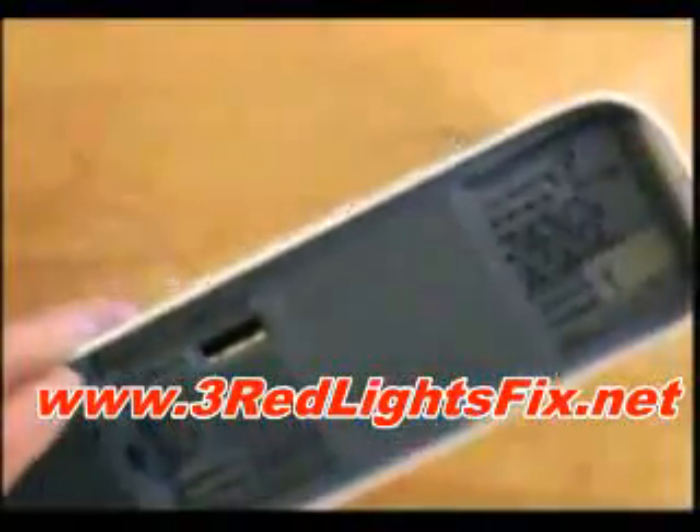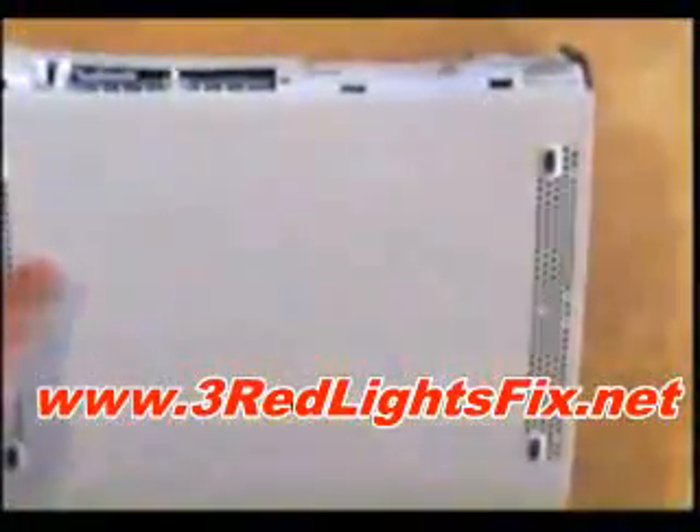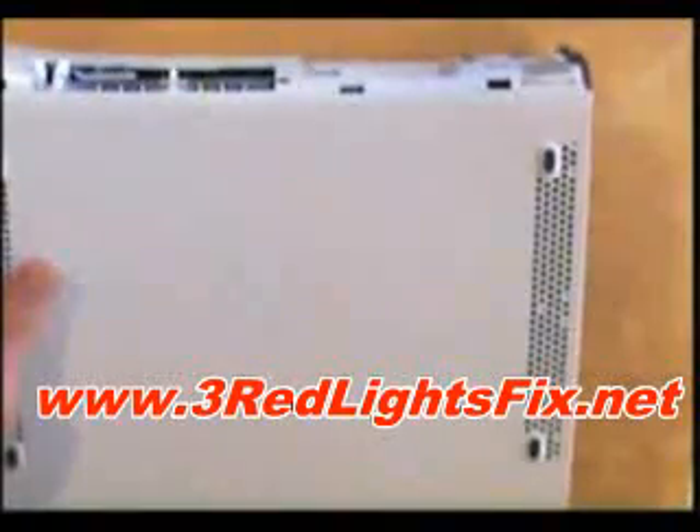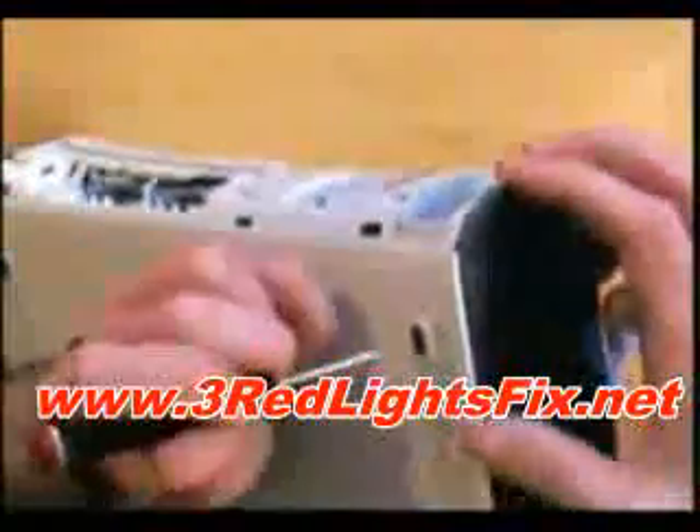The first thing to do is take off your hard drive and then take off the front panel by putting your fingers in here and just pulling it up — and that's that off. Now you need to take off the grey top and bottom. Get a little flat screwdriver, that's all you need. Pull on this part very gently whilst pushing your screwdriver in where the clips are.